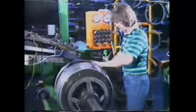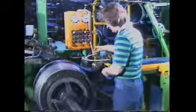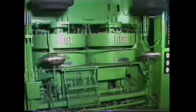Belts of steel wire are guided into place. The tread is then positioned, and the uncured tire is consolidated by rollers before it is placed in the mould. During the moulding and curing stage, the tire is subjected to high temperature and pressure, and it takes on its final fixed identity with its own distinctive tread pattern. It is then trimmed and checked for balance and quality before it is inflated.